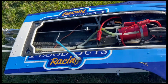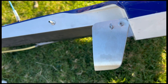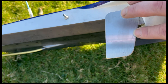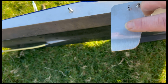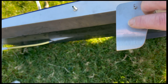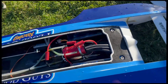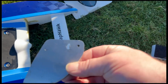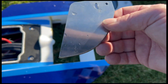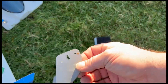Haven't changed anything except the turn fin. This is the original one that Big B has been running for the longest time doing a lot of ovals. The biggest difference with this one is it's a little bit longer, and the rake on the front lip is a little bit less. It's going to have a little more drag, but it's going to be the best turner because it runs a little bit deeper in the water and really hooks. Each one is going to have its pluses and minuses — this shorter one has more rake, giving you good cornering and top end.